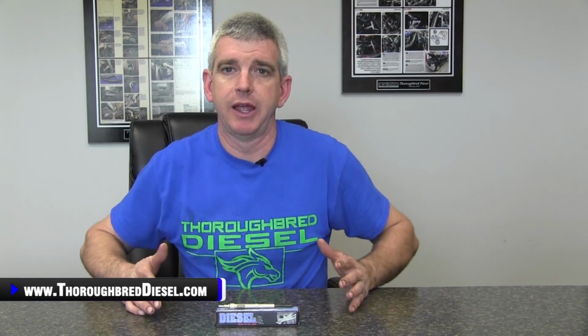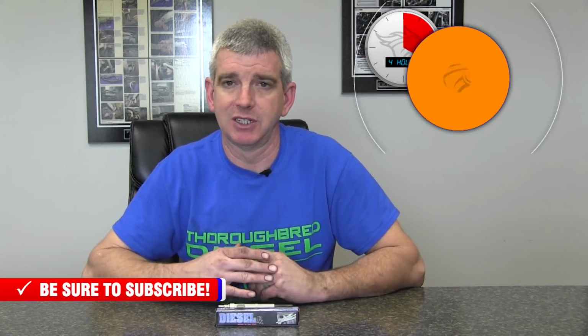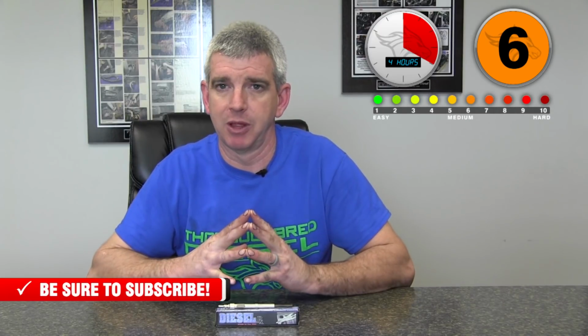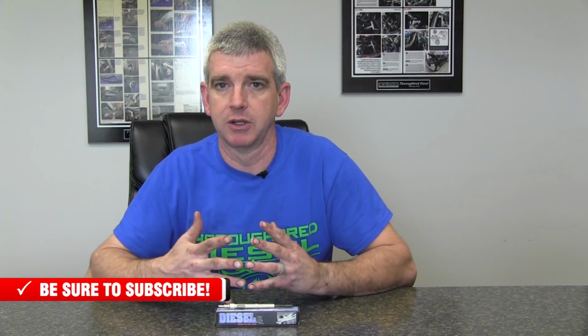The 7.3 Powerstroke is an older platform, light duty diesel engine that's out there today. These trucks have got several hundred thousand miles on them. What we suggest for you is, if you're having any starting problems during the winter time, or you want to raise the reliability of your engine in the colder months, one of the first things you do is replace the glow plugs in your truck, if they've never been replaced or you think you've got any problems concerning your glow plug system.